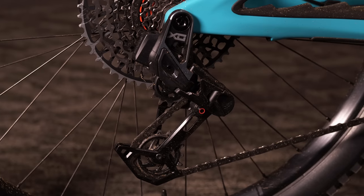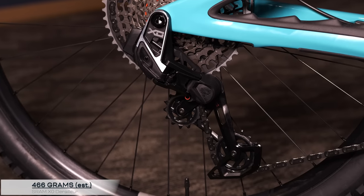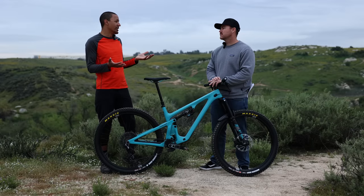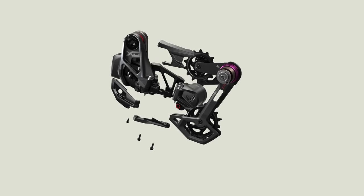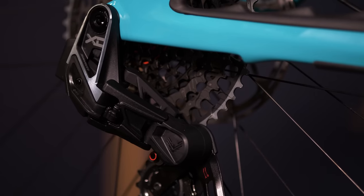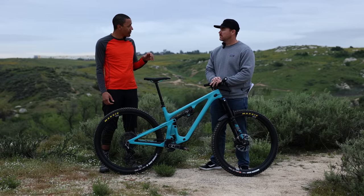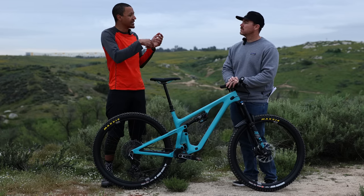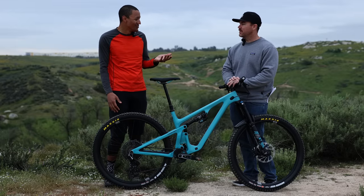It's a big piece of equipment with that direct mount. They've also done a few other things. One thing about current derailleurs is if you crash, it's kind of done — you can't really repair it, one and done. So they've added replaceable skid plates: if it gets scratched or banged up, swap on new plates and your derailleur looks brand new. They've kept the impact feature so when it takes an impact the derailleur will shift in automatically to help protect itself. And then the really cool thing on two of the tiers is called the Magic Wheel — your lower pulley is on two bearings, so if something gets stuck in the pulley, the teeth operate separately and keep spinning so it doesn't jam into your chain or pulley wheel. Really cool safety features built right into the derailleur.